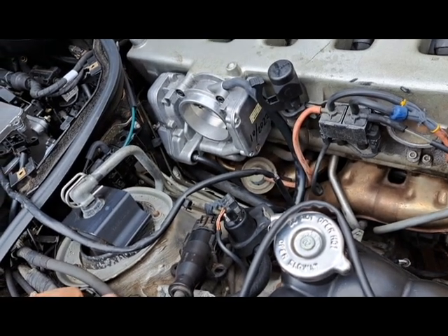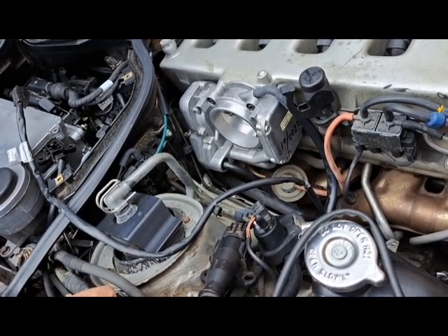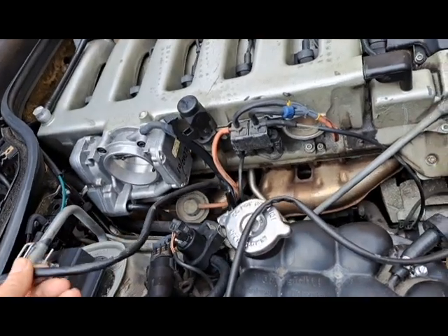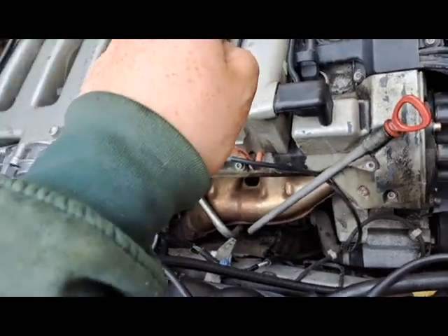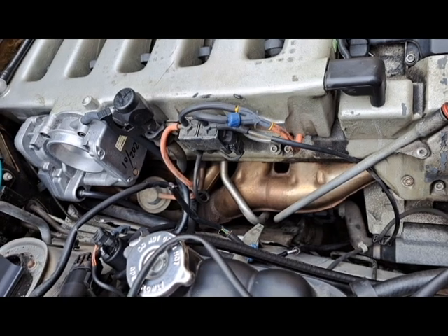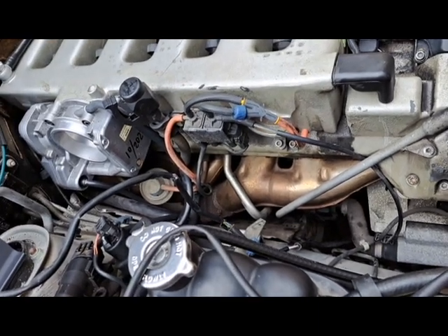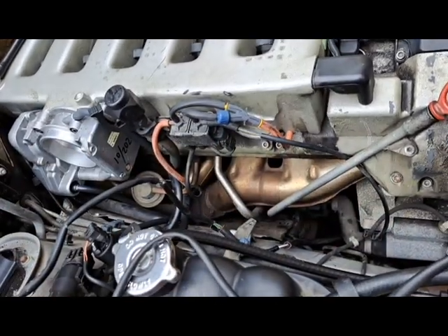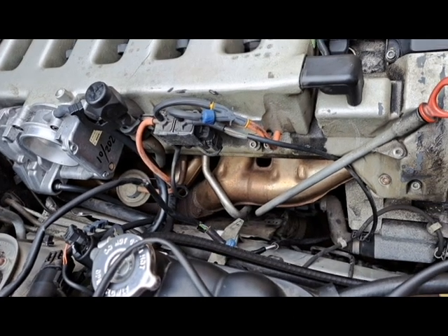On the inside it's actually pretty easy — you just remove one panel and you'll see exactly where it connects up. It just connects with a giant bolt. But the part of this harness that goes underneath the engine is not easy. It has a couple of single wire leads that go off to the oil pressure sender, which is on the driver's side, and another one that goes to the oil level indicator sensor on the passenger side. It's held with a series of Allen bolts and covered in thick corrugated plastic, so it's impossible to get out without removing stuff.